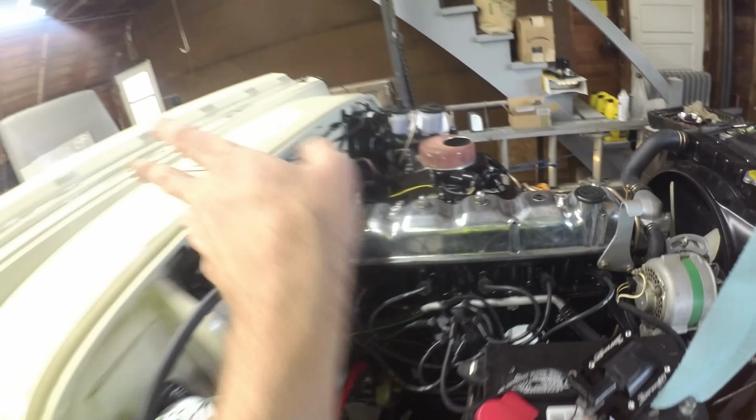So chipping away. I did manage to track down some tubing that works. It's actually heater hose. I had to tweak it a little bit to get it to fit up on the top. Basically kind of carved out a little bit because it's double wall with that cord in the middle. You really only needed single wall for this. It's just a drain tube. So up where the flange is, I basically just carved out the inner wall, and then she slid on. She fit through all the nuggets and stuff. So sitting pretty good there. Then we were able to dunk on the heater box, so that's all tucked in. Still has the, I don't know if you can read it or not. No, probably not. Still has the September of '75 sticker from when they installed the warn hubs.